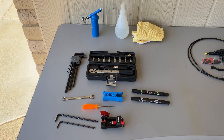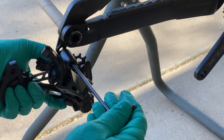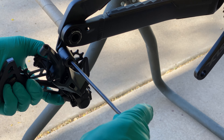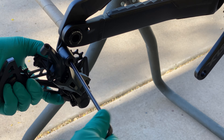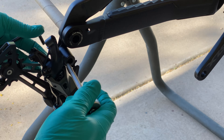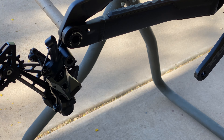As a reminder, I am not a professional bike mechanic, and this is not a how-to video, but how I do a bike build video. The first thing I do is install the rear derailleur. When installing onto the hanger, make sure you properly lift the mech above the stopper on the hanger. The gap screw should adjust against the stopper. Torque down the screw, and we are ready to put the cockpit together.